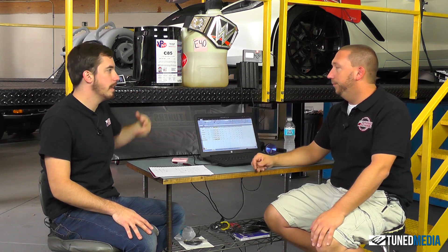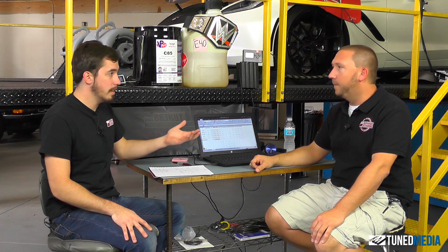We did talk to VP Racing about it and they explained that they created a solution for people that like the ethanol-based fuels, but really wanted something that was a more pure, known, standard output as far as content goes. Which was a huge con for the previous E85 — you don't really know what's coming out of the pump: 40%, 80%, you really don't know. But with this stuff, they say it should come out right at 70, and ours tested right at 69-70. It was right on — actually perfect — which is already a huge plus in its favor.